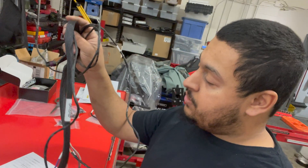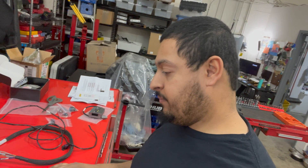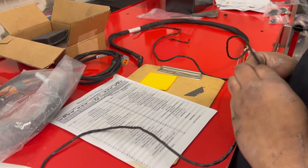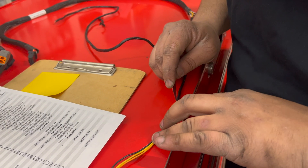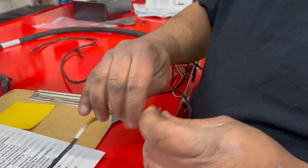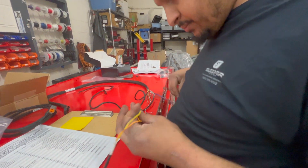Not only their attempt at using electrical tape, but where they had it routed — it was right next to the drive shaft, right next to the steering column, getting pinched off in places with a lot of sharp edges involved. Not ideal. Why is the whole thing electrical taped? Because they decided that would be a good way to loom the harness. You've got to be careful going in between the wires — you don't want to cut any of them. They're such idiots. Don't do this. You'll regret it in the long run.